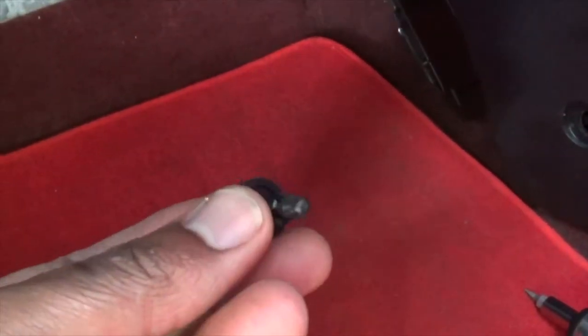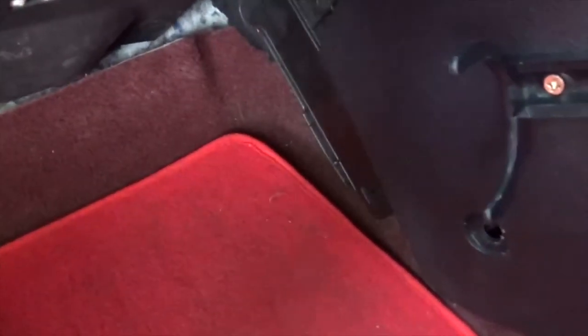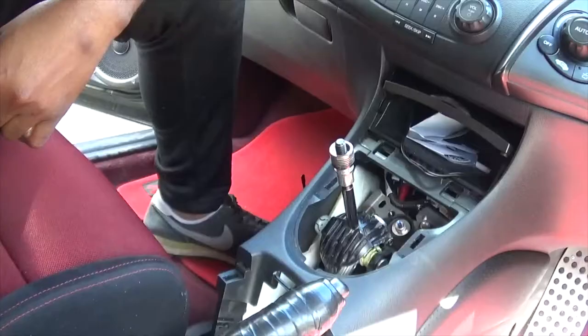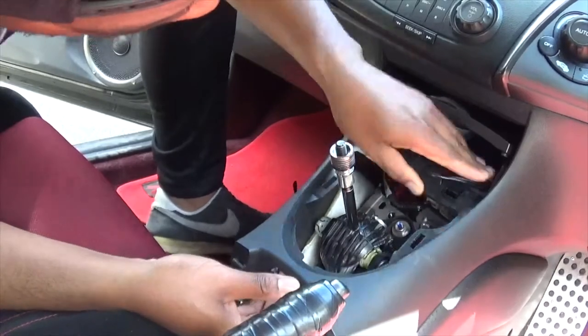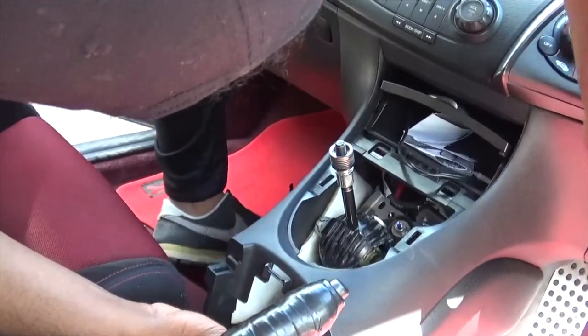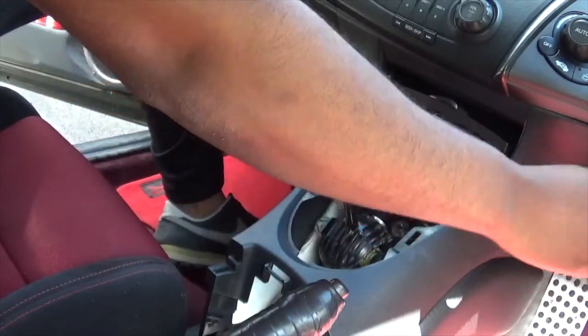You do have to actually remove this front bit as well. To get to that, you'll find on this side you've got a pull-out bolt - it's a little bolt like that. I just used a screwdriver and kind of flicked it out. I'm going to try and keep that safe. I believe on the other side there's another one as well, so get that out too and get the front bit of the dash off.